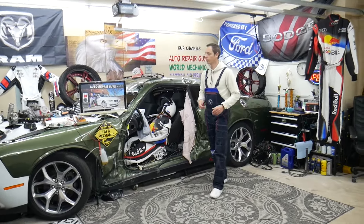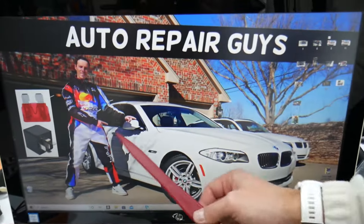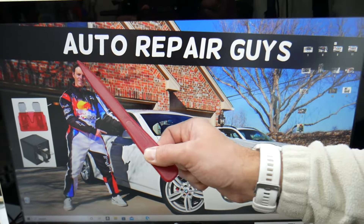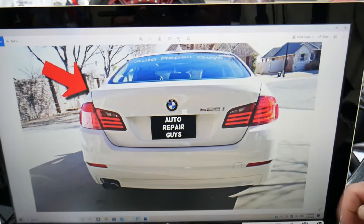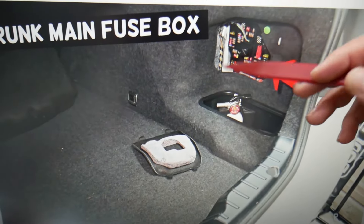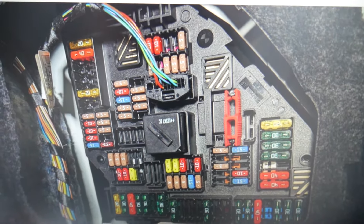For the trailer socket fuse, we'll demonstrate on this BMW 5 Series. You have many hidden fuse boxes all over that car. If you have that generation 5 Series, check out the video on our YouTube channel about fuse box locations on the BMW F10/F11. What you need to do now: open the trunk. Once you open the trunk, on the right side you'll see a cover — you just pull it, and behind it you have a fuse box with a layout like the one shown here.